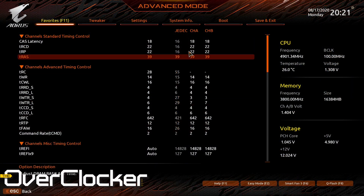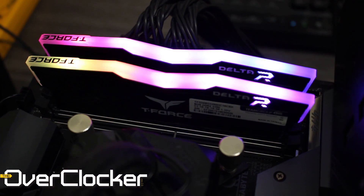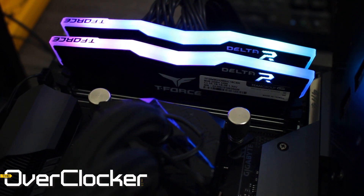The fortunate thing about this memory is that it's so easy to overclock — you don't need more voltage. Just relax the timings to what I used, try 3800 MT/s, and you'll get the performance I got. Overall, R1,649 is a damn good price for this memory, and we've heard memory prices may drop further. Even at current pricing, this is great value for the kit you're getting. It doesn't look too bad either. I think it's an okay budget set — you could do a whole lot worse. Let me know what you think in the comments, remember to like, share, subscribe, and I'll see you on the flip side.